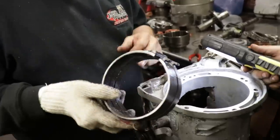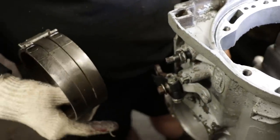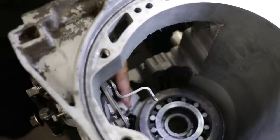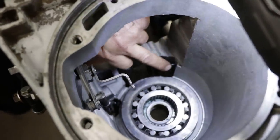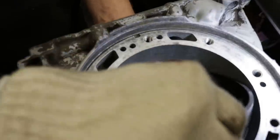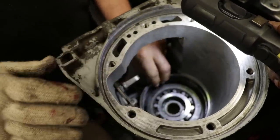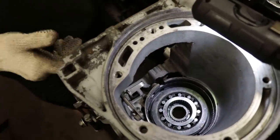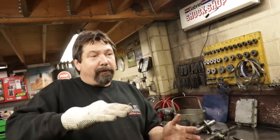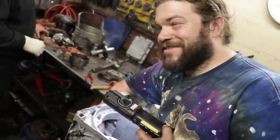If you look here, where your strut rod goes off of this side servo, the case is very shallow here. On this side where your adjusting nut is, it's very long. So you know the band's going to go in this way, just like that. And if you did put it in backwards, the band wouldn't sit down into place. It would sit there cocked. Look at me, rebuilding a transmission.